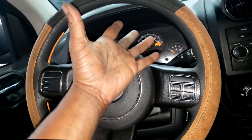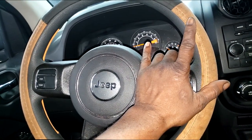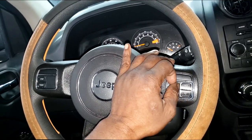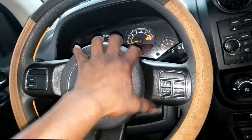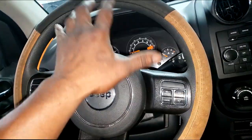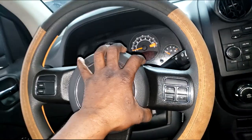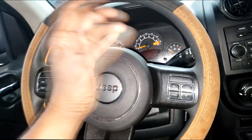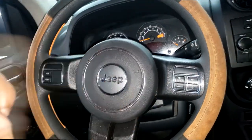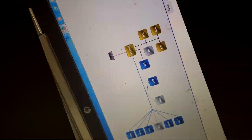Because the TIPM is monitoring the horn circuit, you may find fault codes in the TIPM relating to the horn. As for the cluster, it's just a gateway - the signal heads through there to get bussed over to the TIPM. When I press this, the cluster gets that signal, and I should be able to see a horn sense input in the cluster. We'll look at all that when I get to the scan tool. If I press this and the cluster sees the input, it buses the signal to the TIPM, which in turn sends output power supply to the physical horns. That's not happening right now.